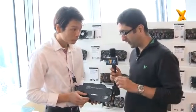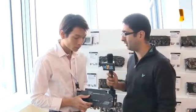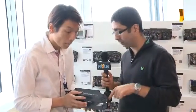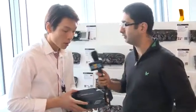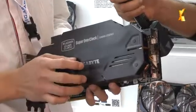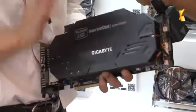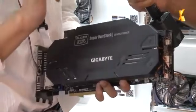Apart from the five fans that we can clearly see, it's a triple-slotter — it's really, really chunky. So what makes up the rest of the cooling on this GeForce GTX 680? I can see heat pipes coming from this side, I can see a huge heat sink. We have nine heat pipes — nine 8mm heat pipes. Previously we used 6mm, but now we have 8mm heat pipes, nine pieces.